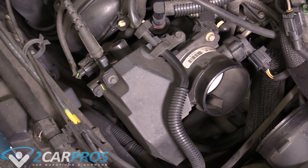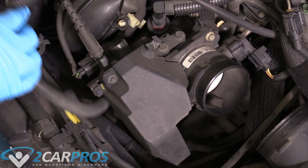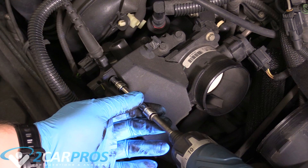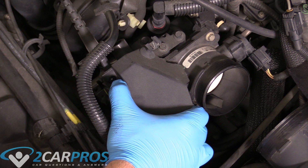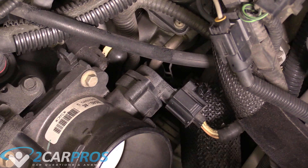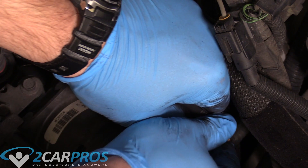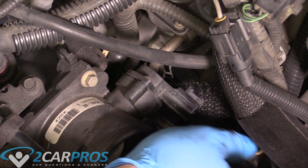The next thing we need to do is worry about this cover here — it covers the throttle spring assembly but also one of the bolts we need to remove. Get this tube out of the way, then use a 7mm socket to remove the cover. With the cover off, the entire throttle is exposed. Next, remove this electrical connector on the throttle actuation sensor — push down where my pointer finger is, rock it back and forth to release the safety, and it comes right off.